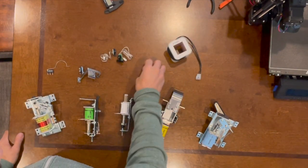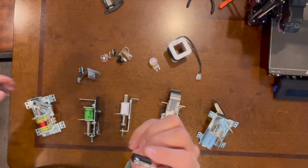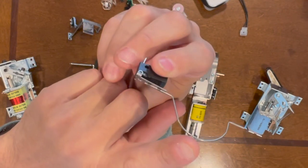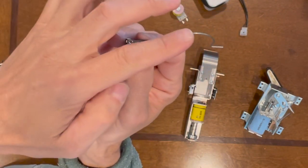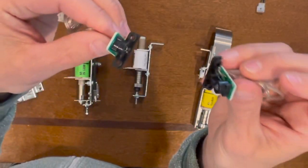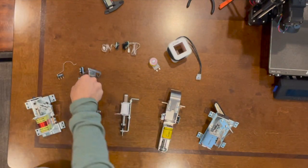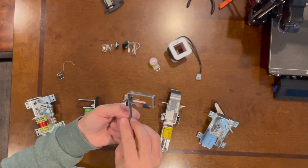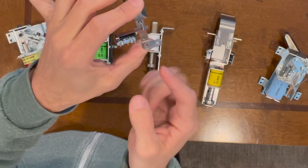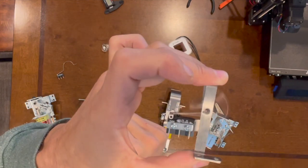With that, the other thing we need to know beyond coils is a bunch of mechanical and optical switches. Pinball machines run off very basic, simple little micro switches — nothing fancy — and lots of them will have different wires attached to the end. When the ball rolls over that curved wire on the playfield, it triggers that switch and we know the ball went through that lane. There are also optical switches: simple little infrared LEDs. Whenever the beam is broken, the machine knows the ball has gone through and can trigger a movement. There's also the spinner — every time it spins around it's hitting the switch, which triggers a count of how many times you've spun it.